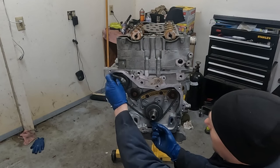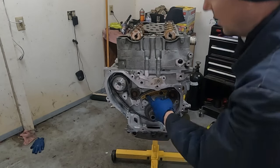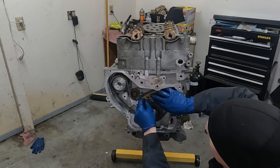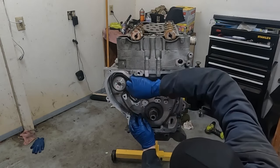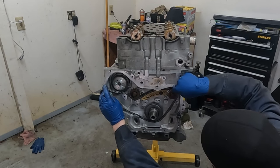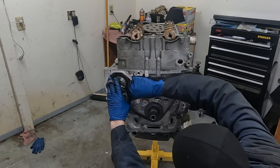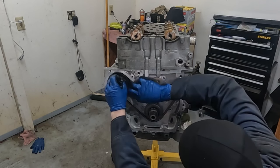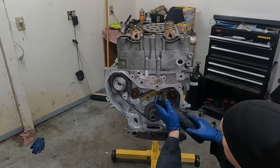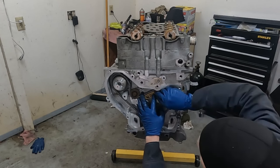Now we'll come around. Now on the water pump, it does not matter how that lays. All right, and it actually may help to pull one of these bolts out. They had us put that on first, but it might be easier to just have it off for now. Okay, and that could just settle. Because we also want this one here to line up with the last colored link. So the gold one on this side, or the uniquely colored one, the next dot here, this comes around like that. So we're lined up there. And then on the water pump, it doesn't matter. So it seems like I even take that off. So I don't know why the manual had me put that on first. That doesn't make sense. So we'll take it off just so we can get this up and over.